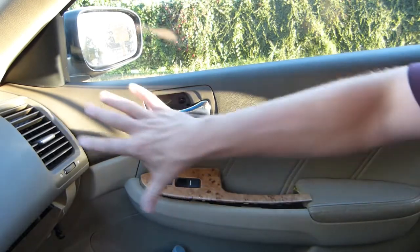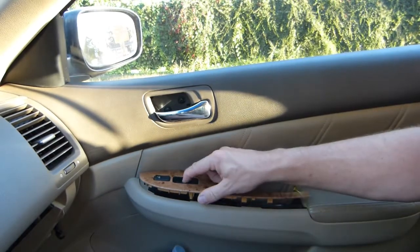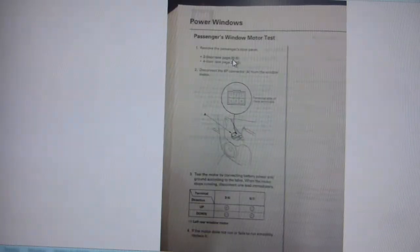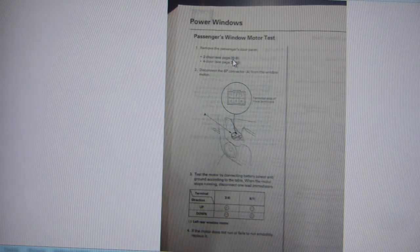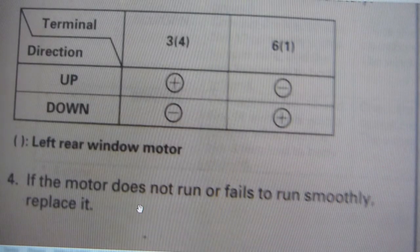The moral of the lesson: when you fix your motor, check the switch and check the operation of the thing. If the window stays down, the motor is not being powered — that's good. It's exactly this lack of finding the underlying cause that is so very wrong with this Honda service manual — it simply sends the technician to discard the motor if it doesn't run. Just throw it away, the whole $340 worth of motor. And if one burns out, replace it with a second one that burns out too in 20 seconds. Put in a third, fourth, and fifth one, and then finally tell the customer it can't be fixed.